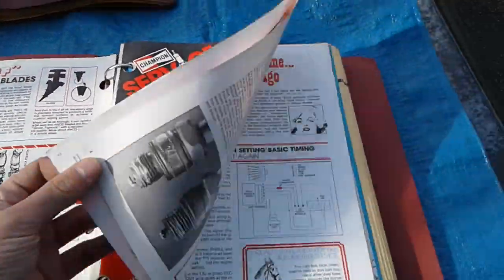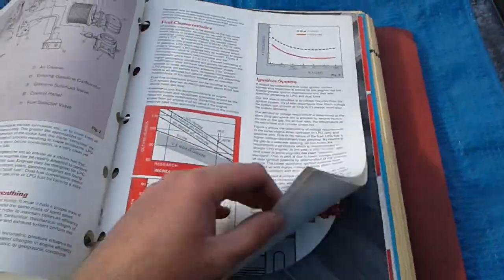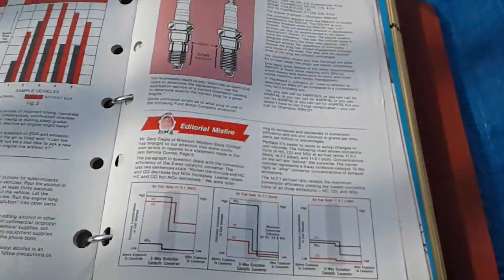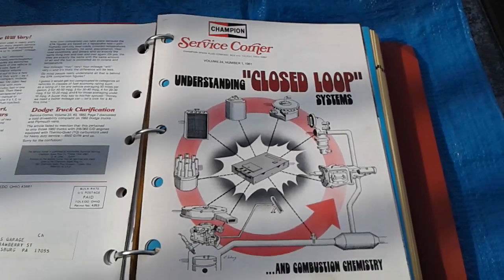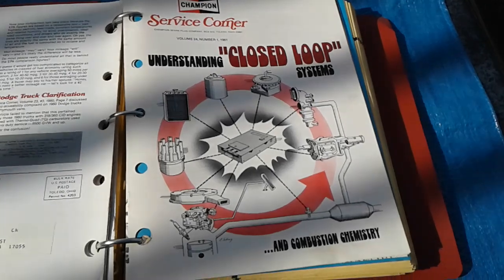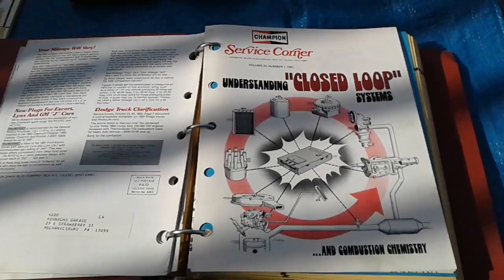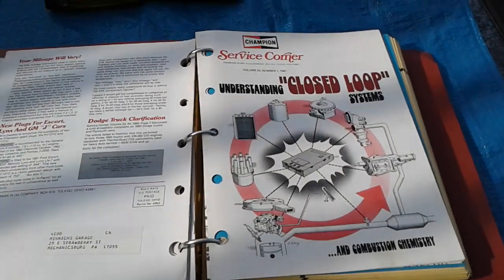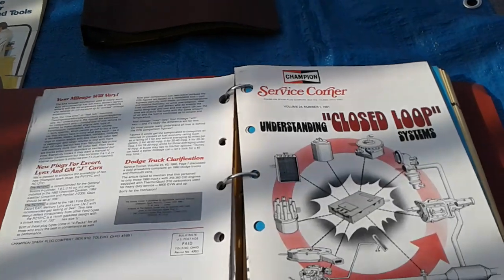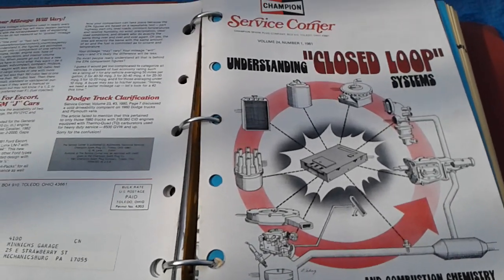There was something interesting in the beginning of this book about closed-loop engines. Understanding closed loop vs open loop — a lot of you know this, but for anybody that doesn't: when computer systems first turn on, when you start the car, a lot of monitors aren't up and running yet and the engine runs in open loop, running on a preset standard from the factory to keep it running until the car fully warms up. Eventually all these monitors come online to the computer, and once every monitor is on, the computer goes into closed loop — meaning everything is ready to go. I had a bad mass air flow sensor in my Regal and every time it was in open loop the car would run just fine, but as soon as the loop closed, boom — the car would barely run.